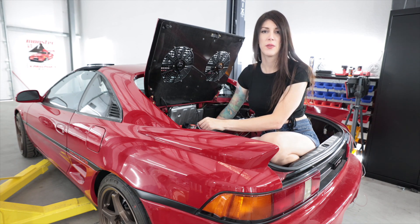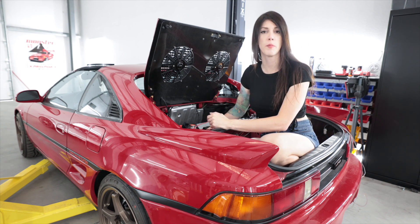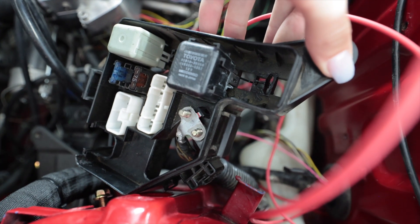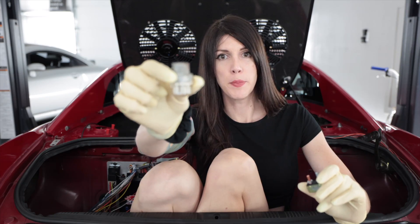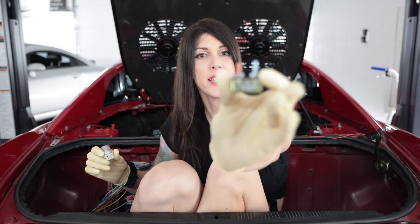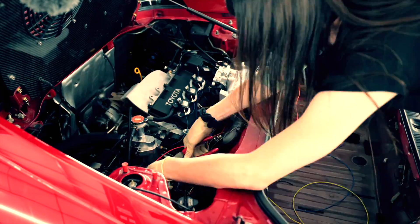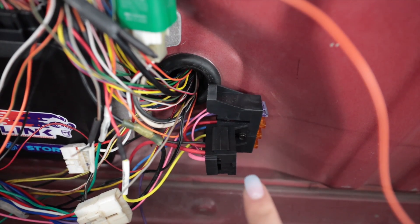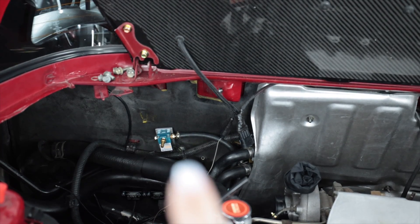Currently I'm in the process of doing probably the most difficult part of this wiring, and that is hacking apart the fuse box back here and converting my circuit opening relay into the new fuel pump relay. This is the fuse box that's back here on the engine bay on the MR2, and I actually took the backside off of it to remove this beer can relay and replace it with this 50 amp breaker. This new relay and fuse bank is what is going to provide power for the ECU as well as the boost control solenoid.